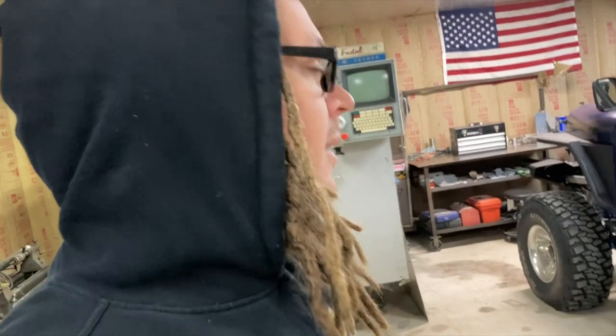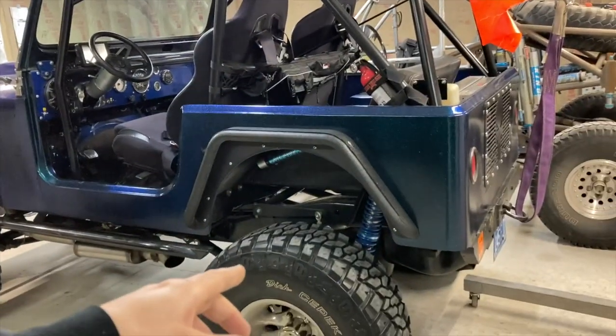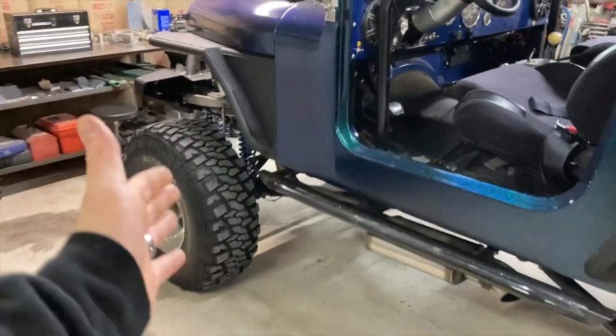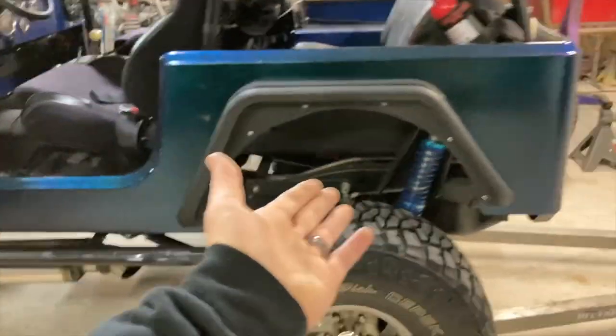So a lot of times with the shock tuning stuff, it doesn't necessarily just come down to the shocks. I'm taking a look at everything. I'm looking at setup, how the shocks are mounted, because oftentimes there's issues elsewhere. And with this, the way that's working, what's actually happening right now is the front has about 7 inches of travel up in the front. So the front can handle a lot more than what the rear can. The rear's only got 4 inches of up travel.